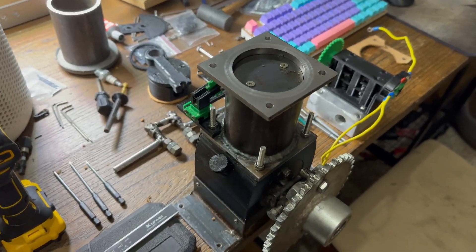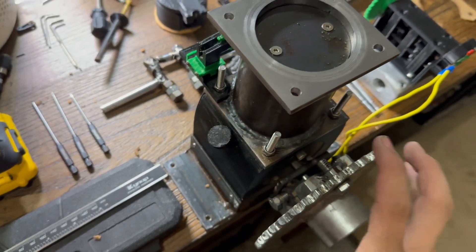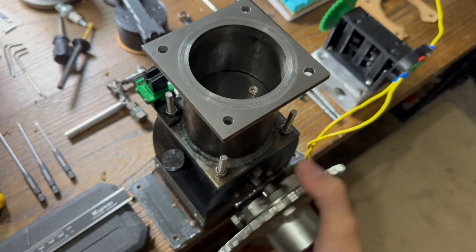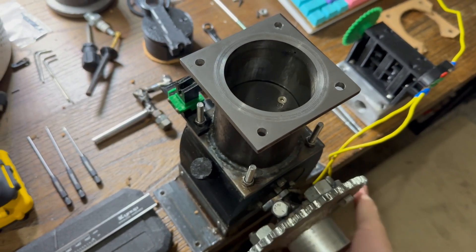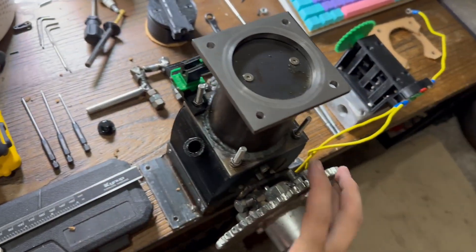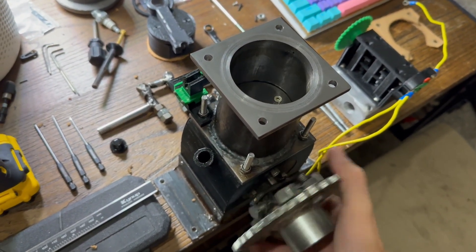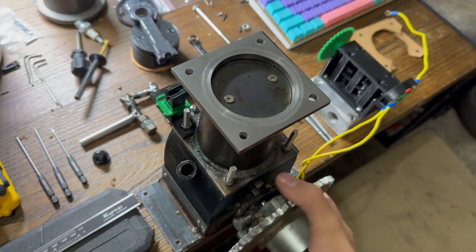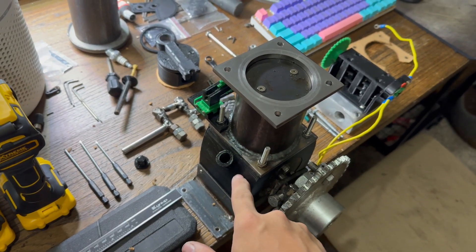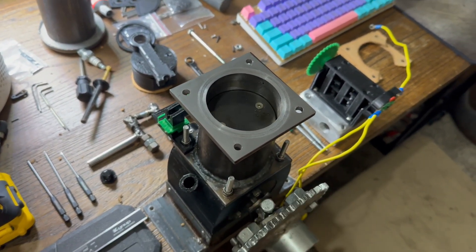I think I just found the reason why it was so hard to pull over. With the oil cover on the crank case it's actually pretty difficult to turn over. Without it, it turns over really nice. I think it was building pressure in the crank case, which is weird because I don't even have any RTV silicone in there — but without the cover it turns over really easily.